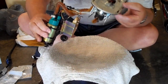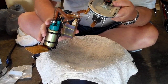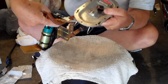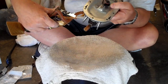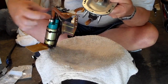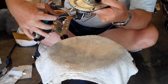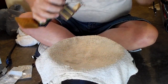When you open this up and get this moved up in your tank, what you'll see is this area right in here. And what I did was I put the screwdriver in this area and just pushed down on it. And that lets it pivot. So the assembly, I found nothing on YouTube really clearly showing that. But basically what you want to do is put the screwdriver in there, just push down, and then that'll pivot. You can pull it out of your tank.